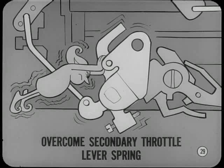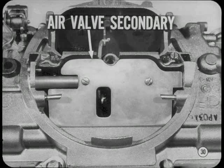You'd better be sure that when opening the throttle valves, you use enough pressure to overcome the secondary throttle lever spring. This spring is very stiff, and if the primary throttle valves aren't open completely, the choke unloader adjustment will be wrong. Thanks, Tech. The secondary part of the four-barrel carburetor should get just as much attention as the rest